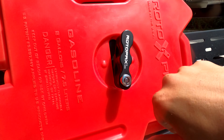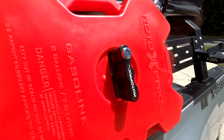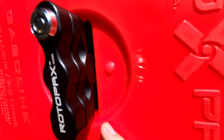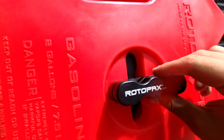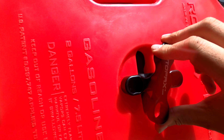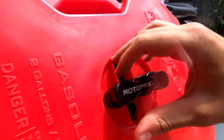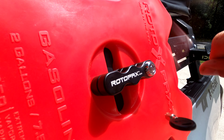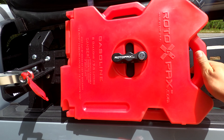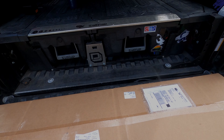So to show it off — I've got the mount right there, I've got the Rotopax and I'm going to set it up against it. This is the macro twist — you go until it's just barely able to clear this little ridge on the plastic. Then unlock it with the key, turn and pull out the core. Just enough so it's barely clearing the plastic, then use the micro twist to pull it down nice and tight against the bed. When it's tight enough, slap the key back in, push and drop the key — there it is, our mounted Rotopax.